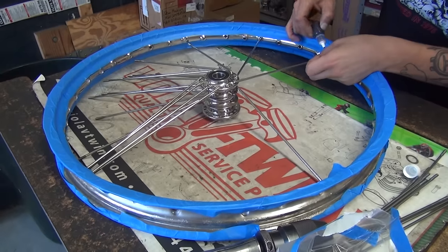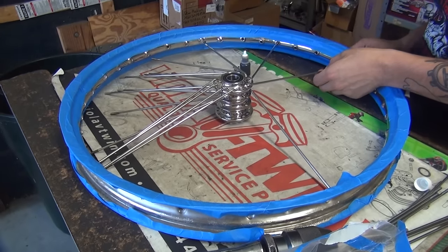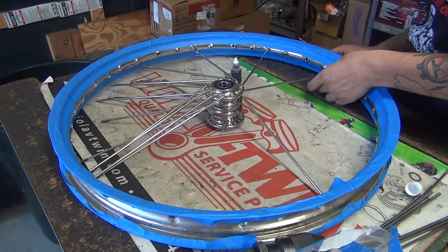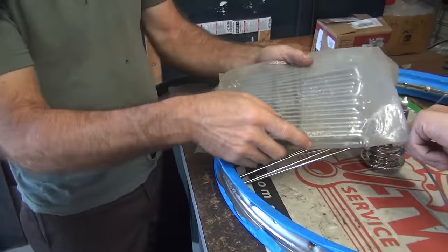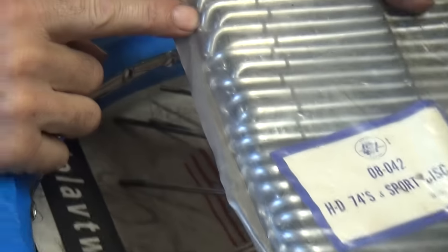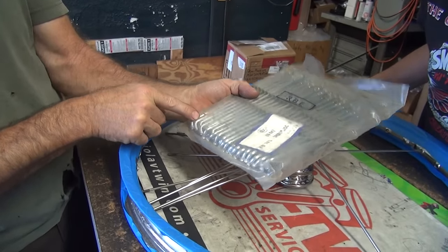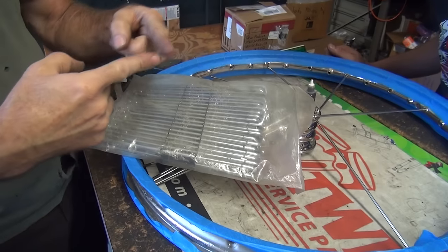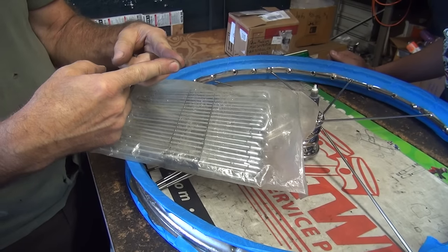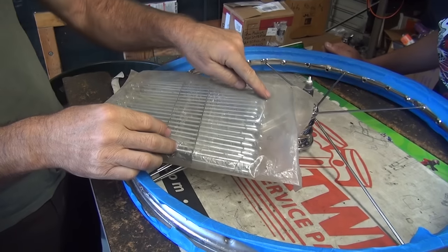You can hear all the spokes he's going through. I just don't understand why there's nipples up there. Because all the other pictures I've seen online - see how long that is? That's because they overlap each other. So the length has to be long enough to go over that spoke. That means this one has to be a lot longer. So we'll go over it, otherwise it has to go through it. Now if two things go through each other they don't do that easily. If you're going to cross, one has to be low and one has to be high. So you have to have one short and one long.